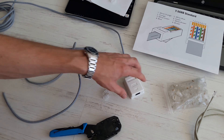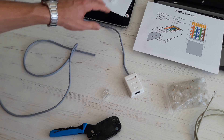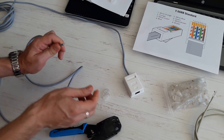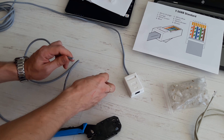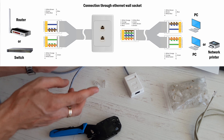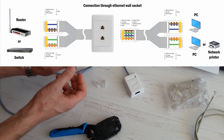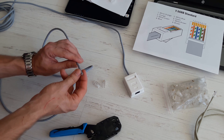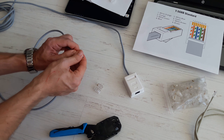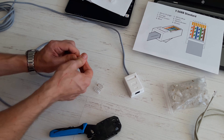In the first case we have one wall jack, one Ethernet cable and two PCs. Let's split one end of the cable and add RJ45 connectors. This trick will not work with gigabit networks because all four pairs of wires are being used. But for most common 100 megabit networks it's real, and you can use the extra wires to connect another device.